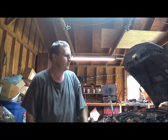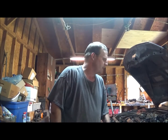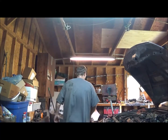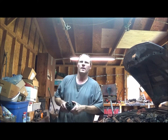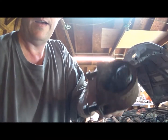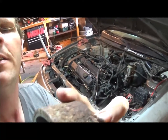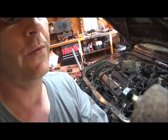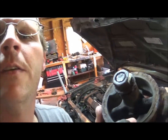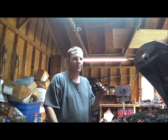What's up guys, I'm back again for some more of the ZX2 project. This thing's just being more and more of a pain in the ass all the time. The CV shaft was no good. The engine damper is toast — I'll even show you the engine damper. They call it a motor mount, but it's the engine damper. You can see it's cracked all the way through on both sides. So I gotta get another one of those. It's only like 17 bucks, but it's still more stuff to replace.